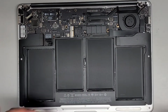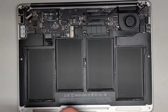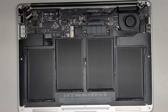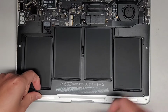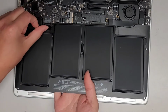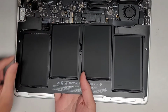We're taking out the screws because if you just yank this battery, the cable here doesn't have enough room to move and you can damage the cable. So you do want to actually lift the battery slightly, to make sure that the cable won't get damaged. After you remove all 5 screws, you're going to lift up the back here slightly and get your hand under and then tilt your fingers up forward like this to lift it. Slightly, just like that, and then grab this connector or the plastic tab here, and wiggle this as you pull it side to side like this. And there you go.